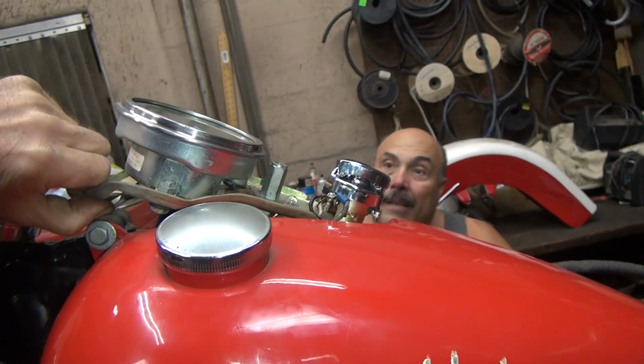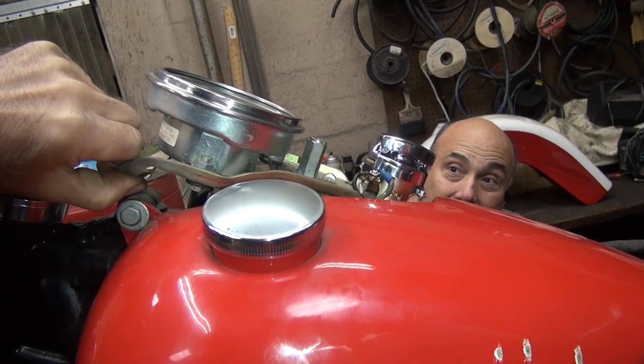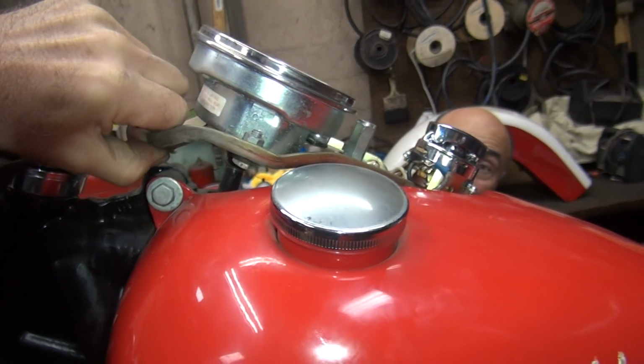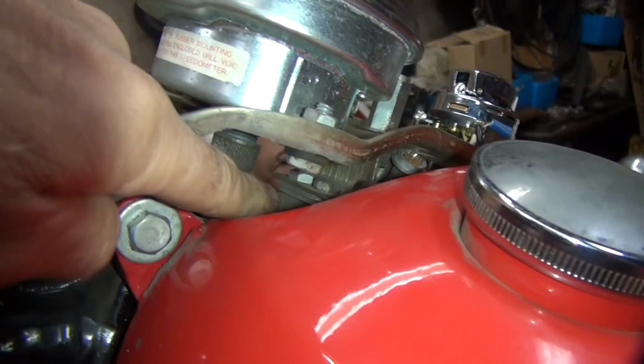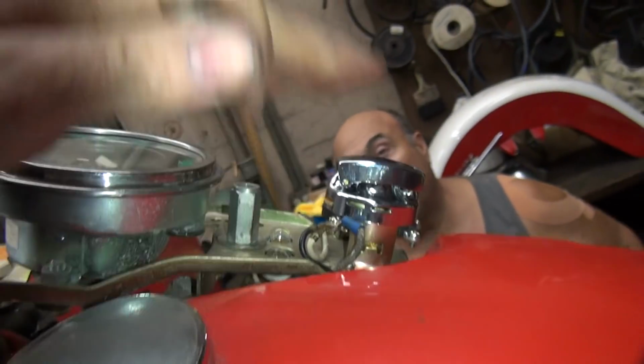Okay, so now when this one goes up, see, this one goes down. Oh, yeah. So that's going to go way down. That might just be, it's going to be too much. We're going to have to raise this thing up more. So we're going to have to come up probably this far in the front. We're going to have to put more stacks of shim under here. And then that should raise this back up and keep us relatively flat. It's all part of doing the job. I told you it was fun doing these things.